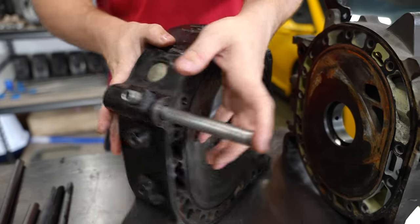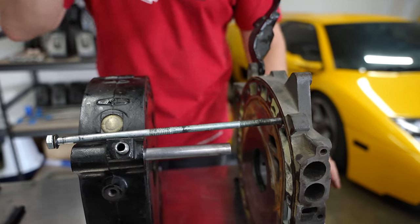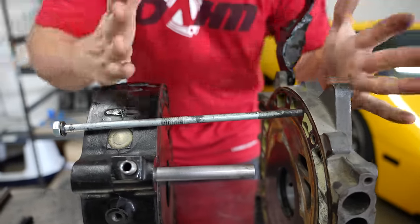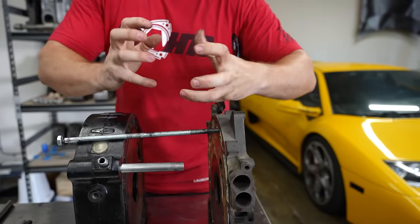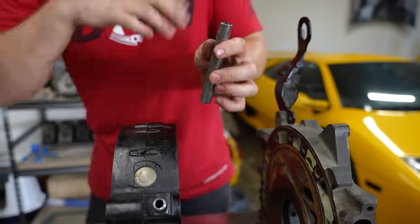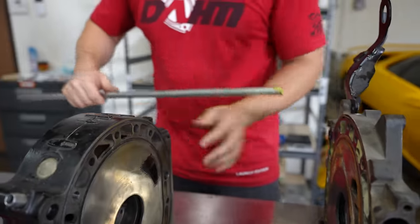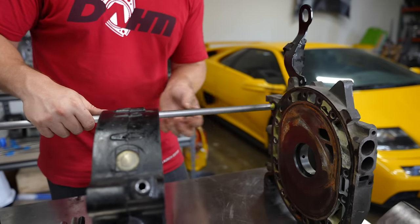This comes down to the next major issue: tension bolts do one thing and they do it decently well, but they aren't supposed to do only one thing. Mazda maybe 30 years ago made a compromise — for 200-300 horsepower, this is not necessary. The tension bolt is straight up designed to sandwich the thing together, but as you make power the engine starts to torque instead, and sitting in front of all that horsepower are two of these just going, well shit, I picked the wrong job. Without modifying the engine too much, you can move to a longer version, or the granddaddy of them all — a 16mm solid dowel. When people say you're solid doweling the motor, you're actually doing two things at once: you're now making a dowel go through that block, and you have to do the external oil mod because oil can't transfer through a solid piece of metal.